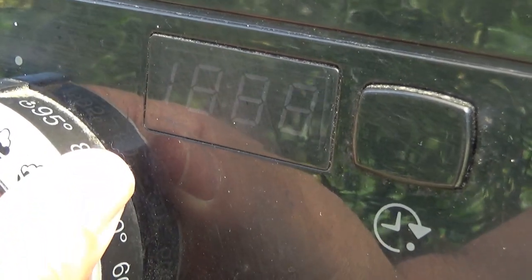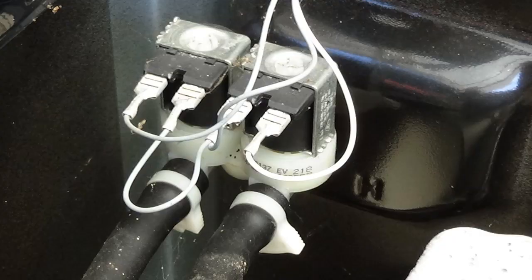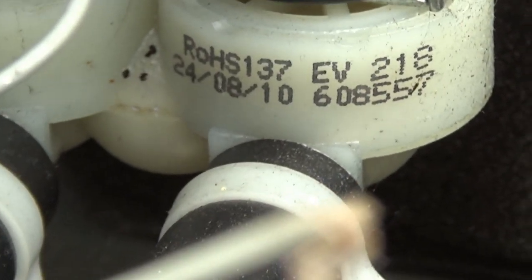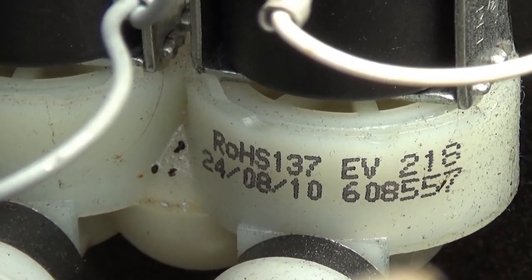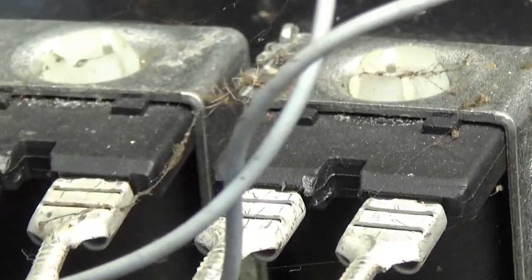Using this machine, let's learn a little bit about the machine's components. Let's go first to the water valves. Water valves always fail in the machine. The main reason is because we sometimes forget to open the water source and they start heating. Always try to pick up the part number from it so you can order the right part. But also, to tell you a secret, these are very standard components and you don't need anything special. You can use another valve in the same place.